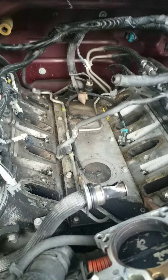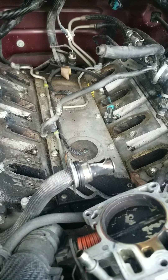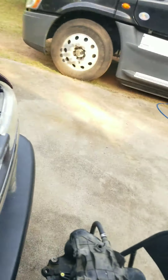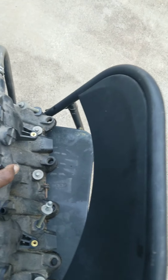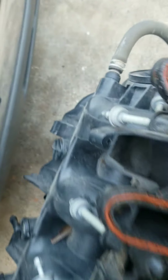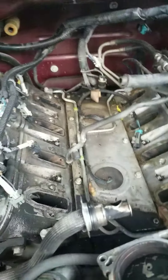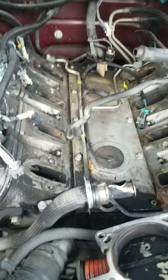So I'm replacing the intake manifold. At the same time I'm looking at it and I see a little wetness on this gasket right here in the back. When I did a pressure test, yes, I got some water leaking out — but I should have jacked the truck up and actually looked in the back of the motor to see where it was leaking.